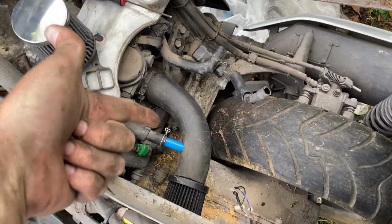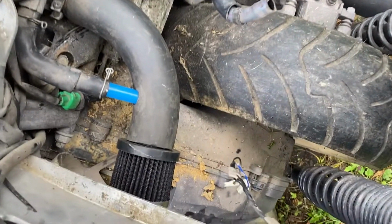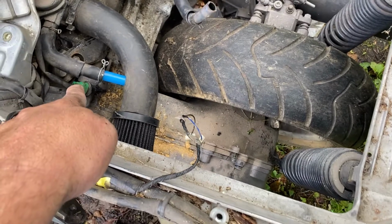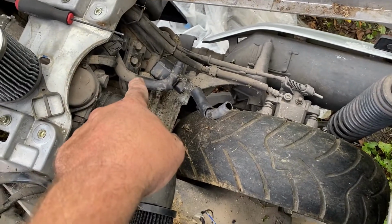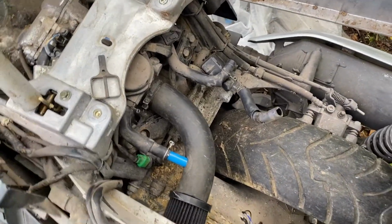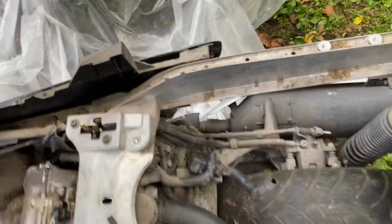All right, boom, got it. So I've got a hole in here which is smaller than that, so I'll have a nice little seal on it. And then I've just placed that filter there just for the moment, and I'm leaving the intake temperature sensor there. Crankcase breather still open. That thing, still unsure, still think it has to do with the exhaust. Not 100% though. That being said, I think I'm gonna start it. Let's see if it'll start. What happens when it starts?